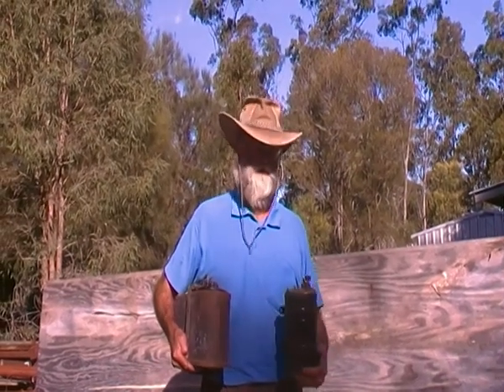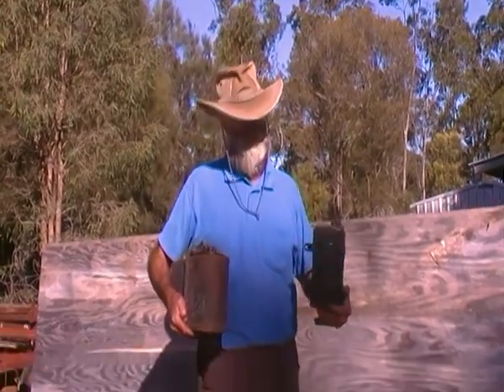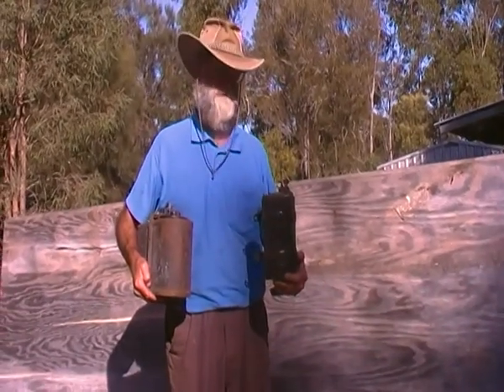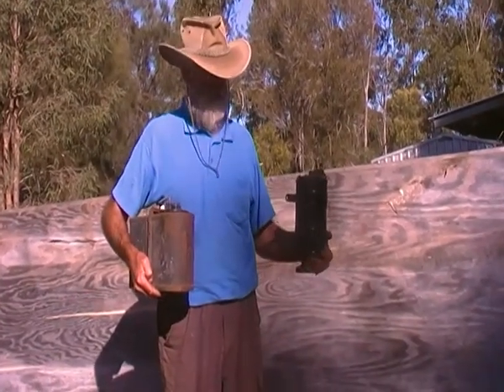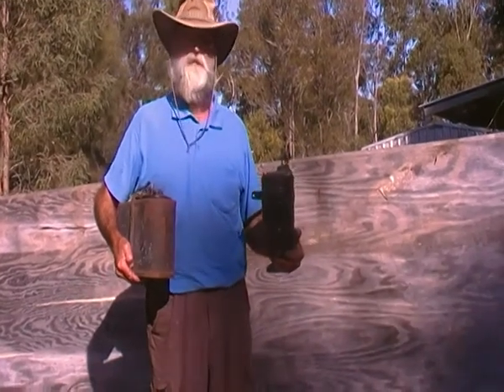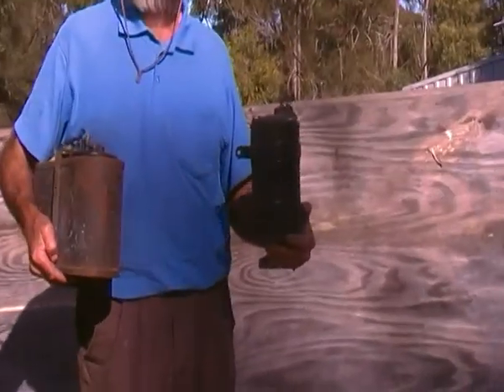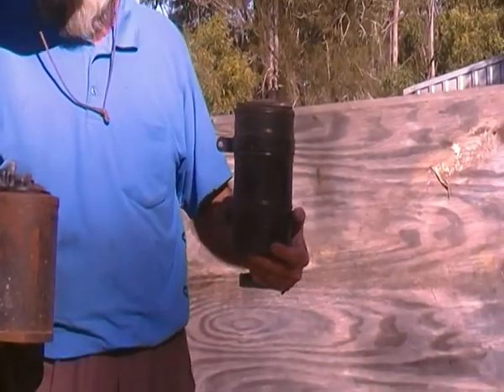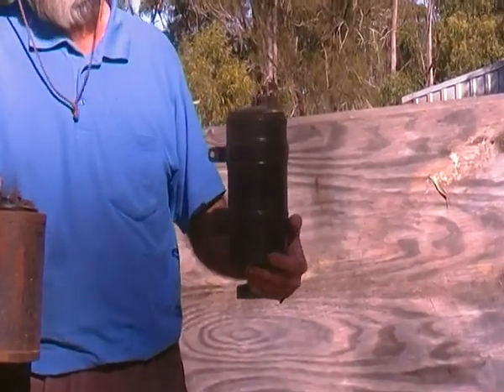Vacuum tank information. This is the normal size vacuum tank that most vintage cars would have. They work by engine vacuum and we'll get into that working on it shortly. That's your normal size. It's in two tanks, an inner and an outer.